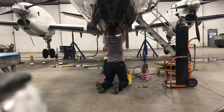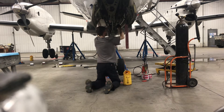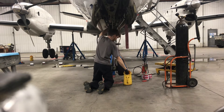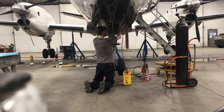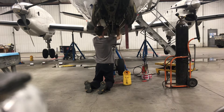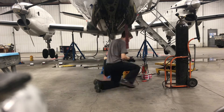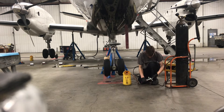What I'm doing here now is using the floating piston. I didn't discharge the strut first, but if I crack one of the bleed screws up top, put a little hose on it and carefully unwind it a little bit, the air charge pushes the floating piston up and expels all the old oil out from the top, and then it stops — that's when you know the piston is at the very top of its travel.